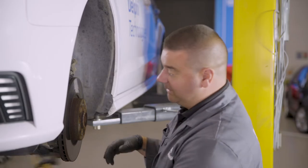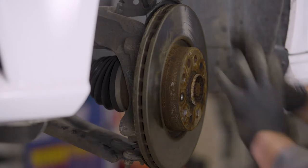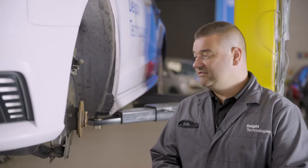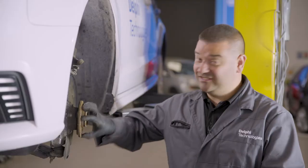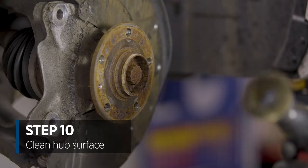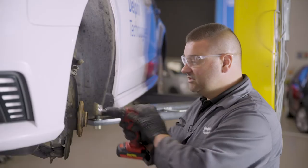Keep working all the way around as you keep hitting it. The disc is freed off — we can now remove it. Discs off. Before fitting the new one we need to make sure this surface is clean, so we get a wire brush on the drill and go around cleaning the hub spotlessly clean.